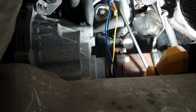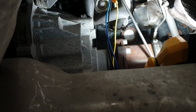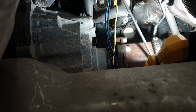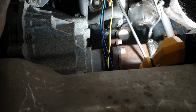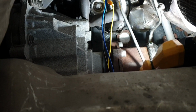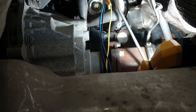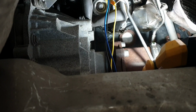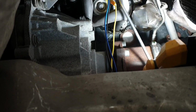At the top right corner is pin 2, which is the signal voltage of the EGR valve actuator, or EGR valve motor, and on the top left-hand side is pin 6, which is the supply voltage of the EGR valve motor. So this is pin 1, which is responsible for the 5 volt voltage reference. I have connected the scope meter: the yellow channel 1 is connected to this one, and the ground lead of the scope meter is connected to number 3.